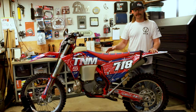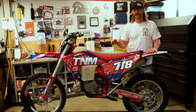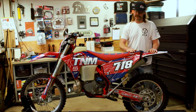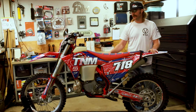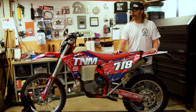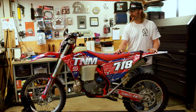Two-stroke performance kit. In my opinion, best option for making your TPI run right, making it so you can ride the bike a gear higher. This bike has the two-stroke performance kit. ECU gets reflash, quick turnaround time from Steve at South Bay Motor Performance. I chose to go with the high compression head on this. Works really well up at elevation and still runs fine on 92 ethanol free down at sea level in the wintertime as well.